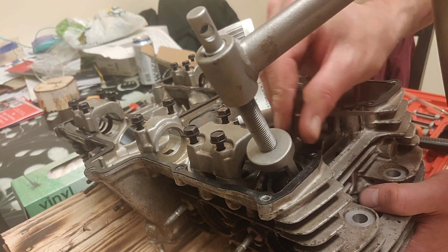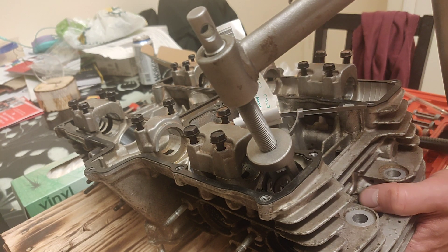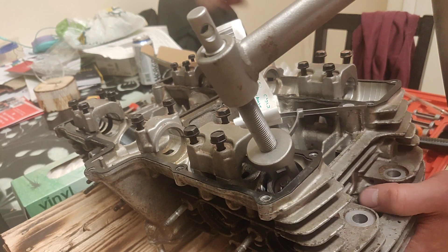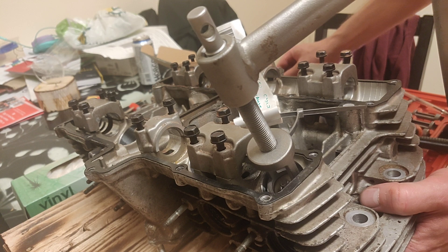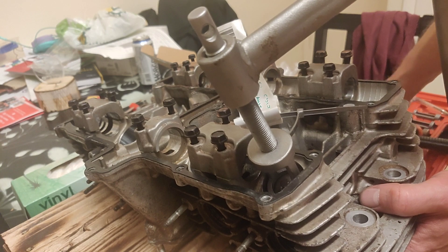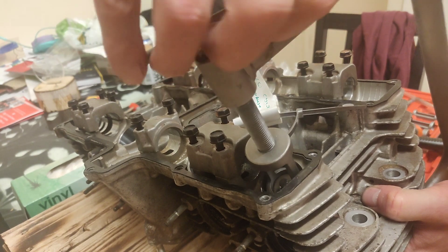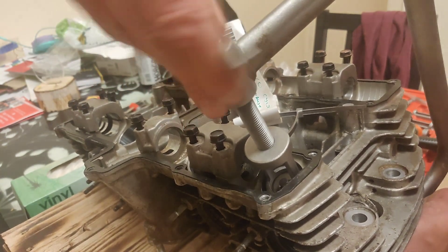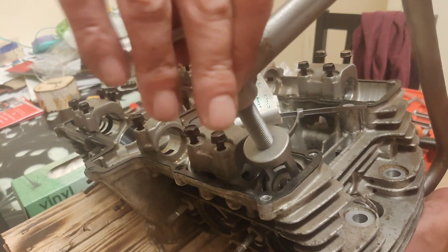The pop may have just lost one of the collets, so just put something magnetic in there to drag it out. And there's the other one - it had popped but it hadn't gone far, which is good because they are a bugger when they've disappeared. I've never actually lost one, and they have the advantage of being magnetic, so wave a magnet around on the floor and you'll find it - particularly if you're in the kitchen rather than in your garage.